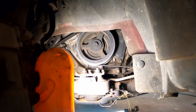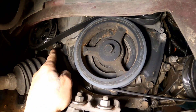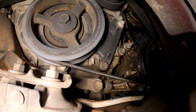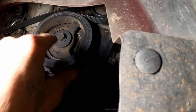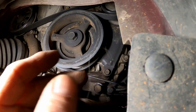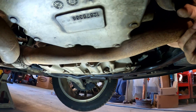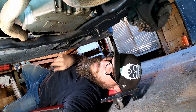With the wheel out of the way, we can get a better look at what's going to have to come off. There's this bracket here - this is actually the motor mount itself - and all these bolts thread right into the pan. Even the AC compressor threads into the pan, so obviously we'll have to take that off. The pulley has to come off too because there's a bolt hidden right behind it. We're also going to pull the exhaust since it runs right under the pan and there's no way to get the pan off with that in the way.